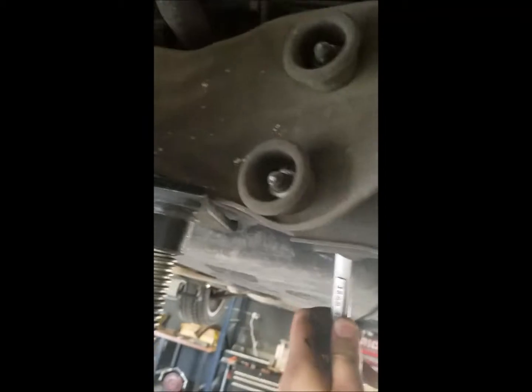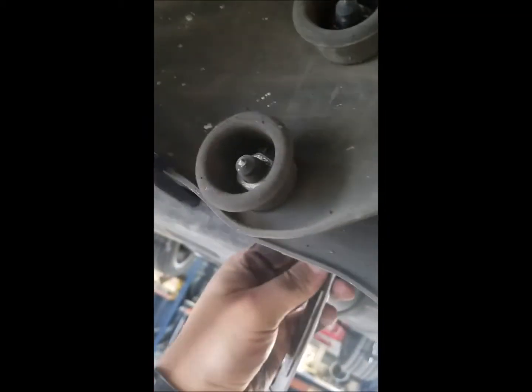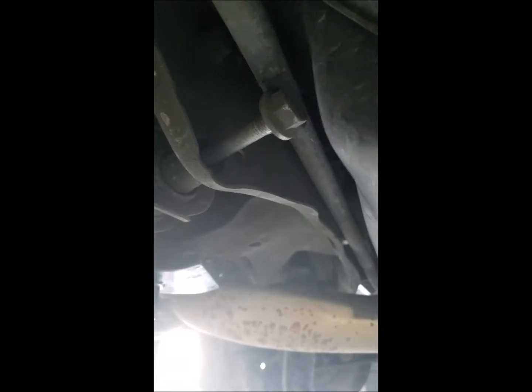Let's start with the hardest side first, which is the passenger side. Put an 18 millimeter socket on this bolt and hit the air gun on the nut — 18 millimeter as well. It takes two hands. Once it's out, you can see the bolt wants to hit this plastic gas tank right here. So you just pull down on the subframe to get some clearance. Off camera, I'm going to get a helper to pull on the subframe while I wiggle this bolt out.